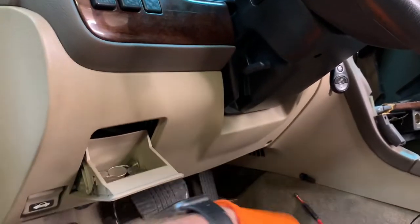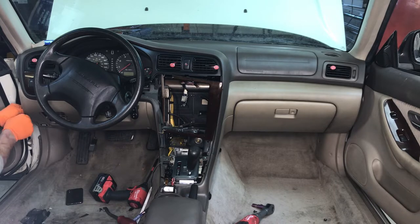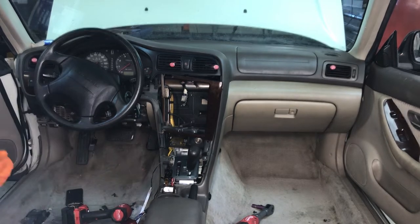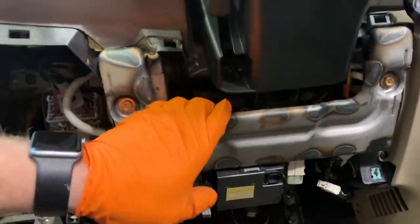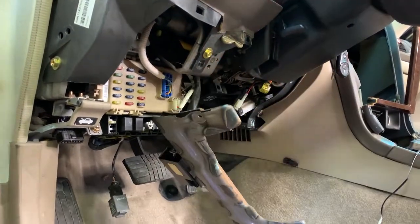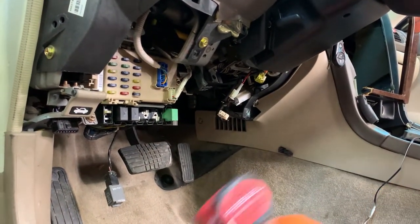Anyway, so we'll get this part off and then we'll start underneath there and keep rolling. All right, take our little pick, pop those guys out. All right, you can add that. Once we've got that fascia piece off, we've got this little guy, so one, two bolts there. And then we're gonna drop the steering column after that. And I'm also gonna get my 10 mil and start taking off all the 10 mil stuff that I see. And we'll get this little side piece too. Don't need that at all. Going back there and then back to the 10.